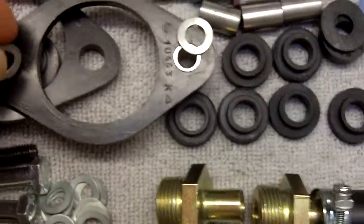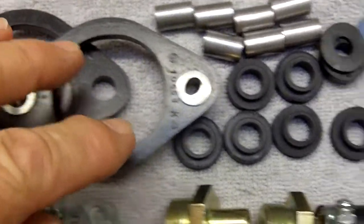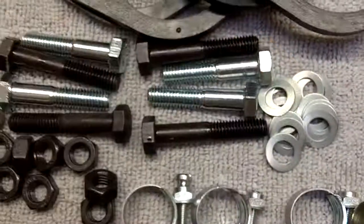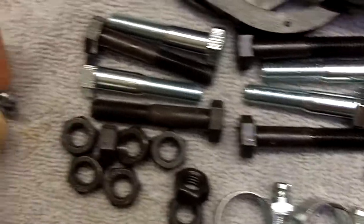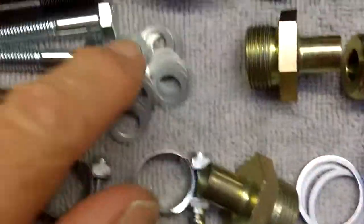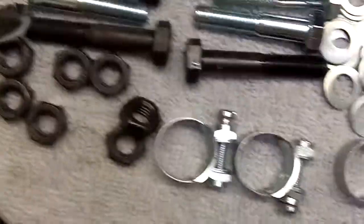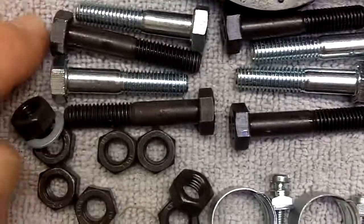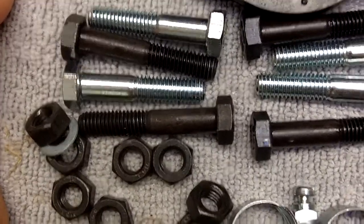I gave you enough wave washers to be used where the carburetors mount to the intake manifold, then where the bolts go through and secure everything, and then the wave washers at the back end of the bolts. I gave you too many of these — you don't need the split washers, you are just using the wave washers. So you have 16 wave washers: 8 against the rubber and 8 against the nut at the end of the bolts. You have two lengths of bolts — the short ones go at the bottom of the intake manifold for the carburetors, and the long ones go at the top. The long ones are because you have your throttle support bracket on the top of the first carburetor, and on the top of the second carburetor you have the hot choke mechanism.